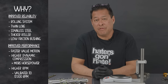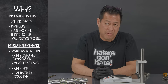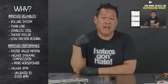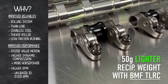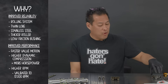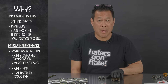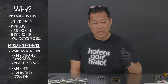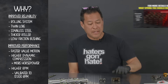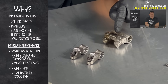A really important factor in achieving high RPMs is reducing the reciprocating weight of the valve train. Additional weight requires more valve spring to control the valve — the faster you spin, the less weight to control means less valve spring you have to run. Before, they were trying to control 125 grams, requiring at least 65 pounds more spring pressure. You have all that additional spring pressure working against a single lobe that's sliding — guess what? It's going to wear out.